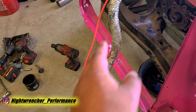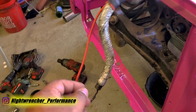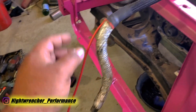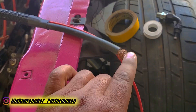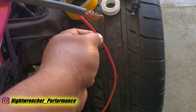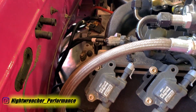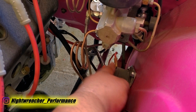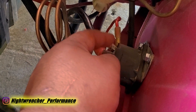Before I get this cranked over I need to install the starter cable. This is actually the factory starter wire that came with this engine — the one from the truck is completely different so it won't work. I've got this wire plus a 10-gauge red wire, wrapped in some painless loom with heat shrink on the edges. I need to put an eyelet on both ends. The starter wiring is now wrapped around the engine, all hooked up, with all battery cables and starter wires terminating at the starter solenoid — so later on I'll be able to use this to pass tech at drag strips.